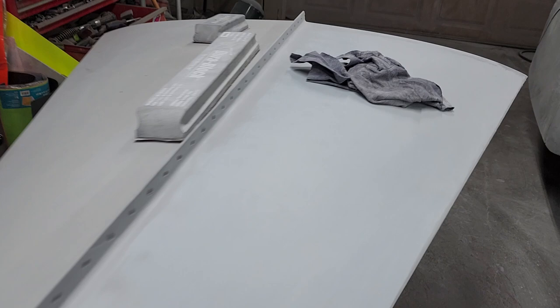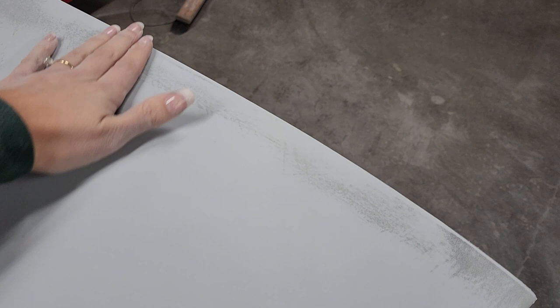So where you got a low back in there by the back of the hood, you see all that guide coat? That is low. So what's going to happen? You're going to have to keep cruising there and dig that primer down to make that come down to one playing field, or you hit metal or whatever's there, filler. Go to the ocean floor if you can, or go as long as you can. Got ocean floor up the front? No, not yet. Well, you're going to have to take that down some more too. That's why all that primer.